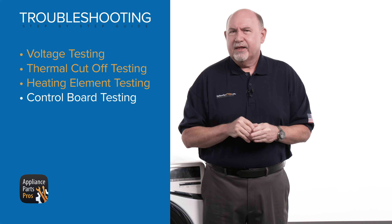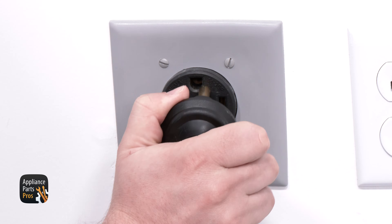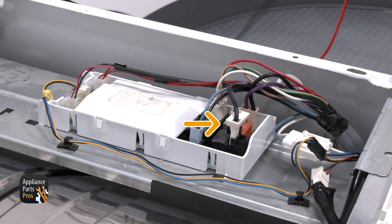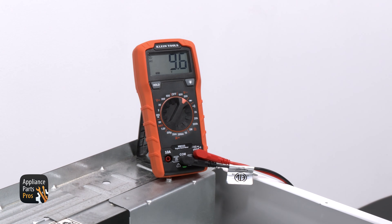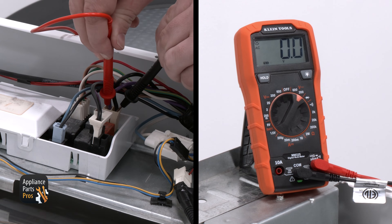Now let me show you how to check the relays on the control. There are several ways to do this and I'll show them all to you. With the dryer plugged in or the breaker turned on, start the dryer and make sure it's set to heat. Then set your multimeter to volts AC and go to heater relay one. Remember we are working with live voltage so be very careful. Touch one probe to the black connector and the other to the violet connector. If the relay is closed, which it should be, you'll get a zero voltage reading. If the relay is open, you'll get a different voltage reading and you'll need to replace the board. Do the same with the other relay — both should show a closed relay, which would be correct.